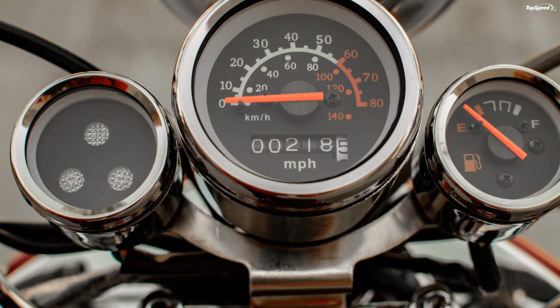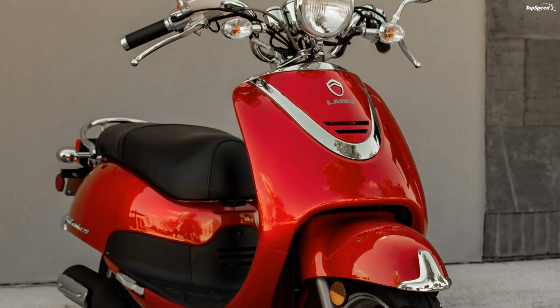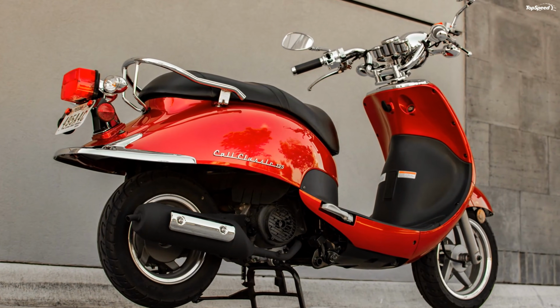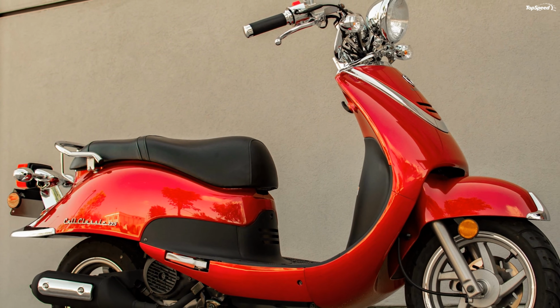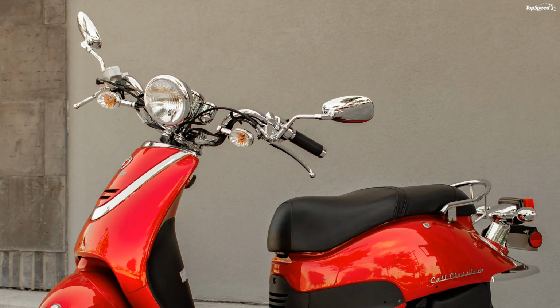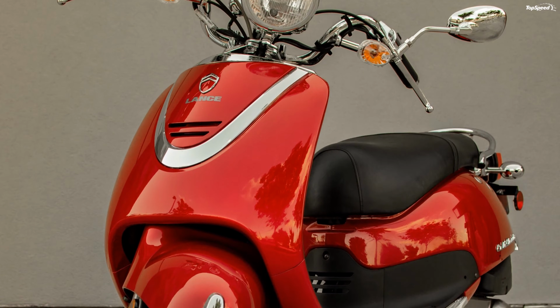At the top end, we have the 169cc 200i. Big Brother runs a 10.2 to 1 compression ratio with electronic fuel injection that replaces the carburetors favored by the other two. At 5,500 revolutions per minute, the engine cranks out 9.21 pounds of torque with a total of 11.8 horsepower on tap at 7,500 revolutions per minute.